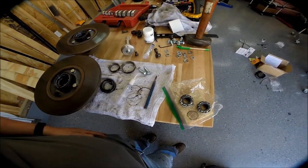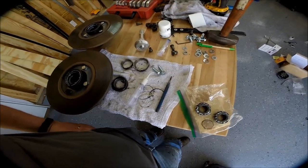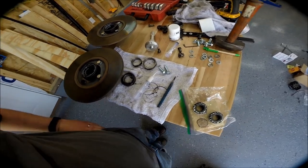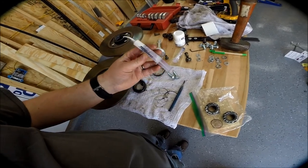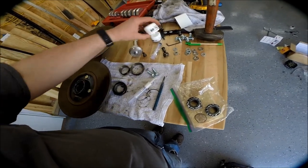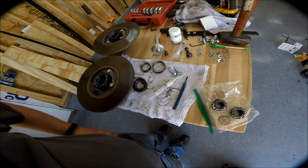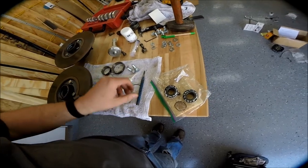By doing a lot of research, I found that most bearing manufacturers, especially for racing bearings, recommend that you don't use that much grease and that you actually inject the grease into the bearing. So I found this handy little syringe on Amazon for a couple bucks, and it worked out pretty good. I use the Day Lube nano ceramic racing grease, made here in Dayton where I live. It's a high-performance grease and you don't need to use as much of it.